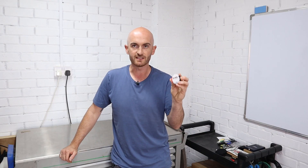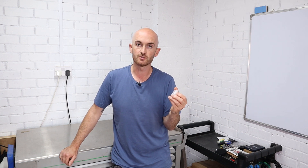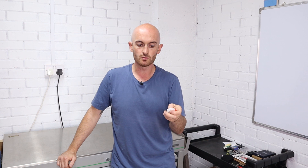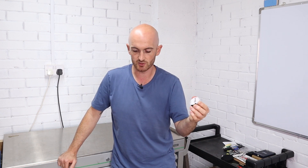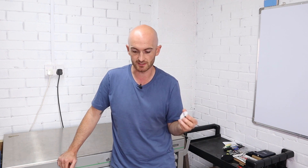So what's the verdict? I think it's amazing and I'm definitely going to be taking this everywhere with me, however it's not going to replace my Picoscope and other test equipment. With Picoscope you can do a lot more analysis and get clearer images due to the higher sample rate. But we did the basic multimeter functions, captured injector waveforms and CAN bus measurements. There's also a spectrum analyser feature we didn't look at, which is great if you're into audio testing. Really good — I'm really impressed, go and check it out.